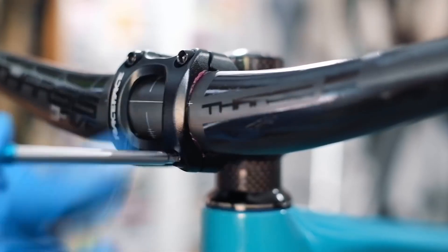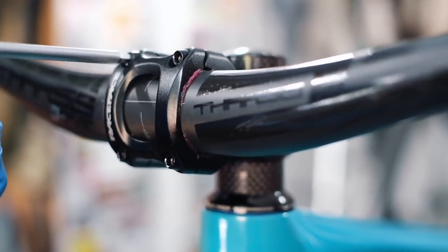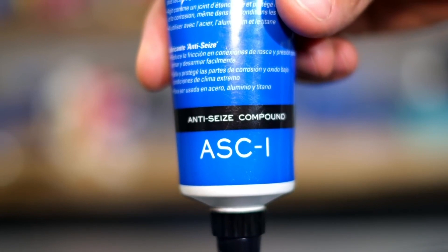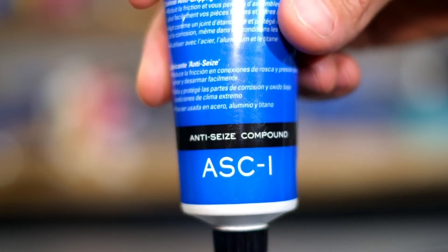You can get away with grease on almost all threads on a bike — just don't go overboard. You need a small amount and it goes a long way. I'm going to put a link in the description to a video about different greases, thread locks, and assembly compounds where I spell out the differences. You don't need all of these things — figure out what works best for you, and there are some recommendations in there as well.